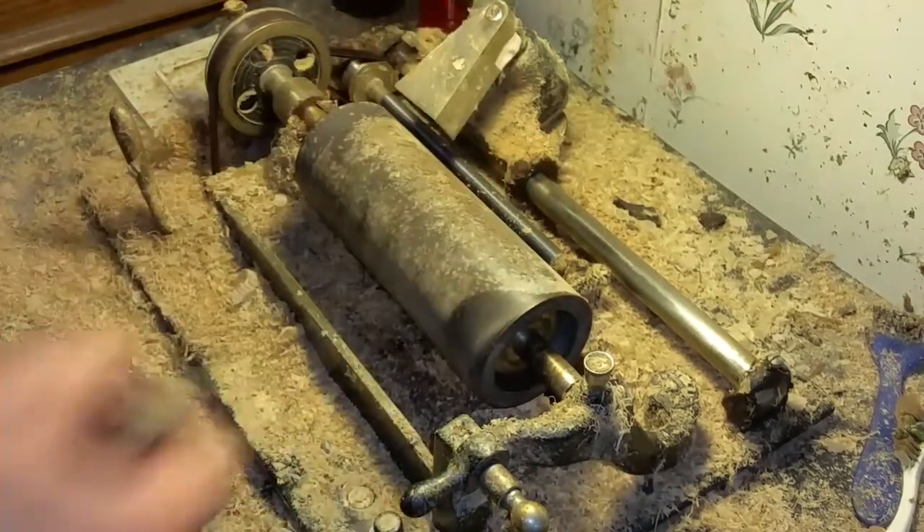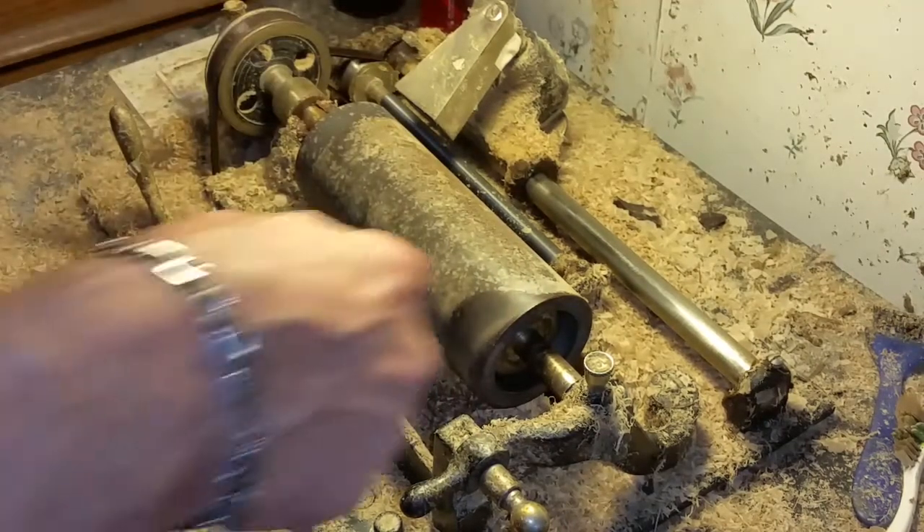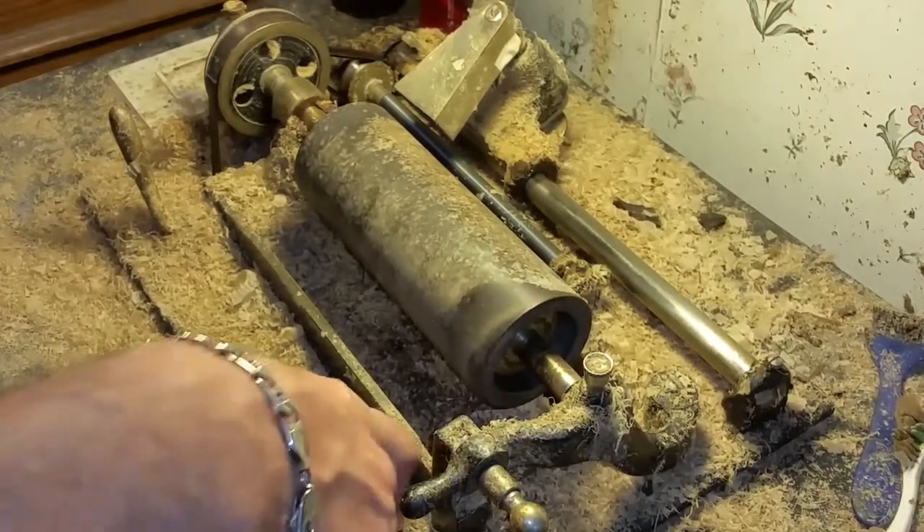It's much harder than wax and it will dull your cutter. What I use is just a box cutter blade, and this is where the mess comes from. Rather than shaving this off, I'm going to scrape it off. That will give us an idea of the actual physical condition of the cylinder itself. As you see, it's pretty bad right now.